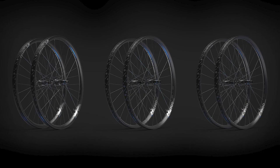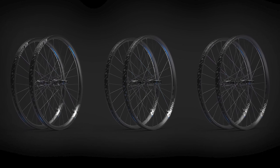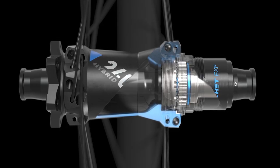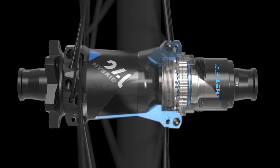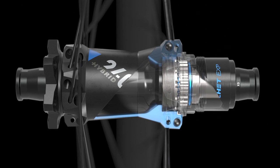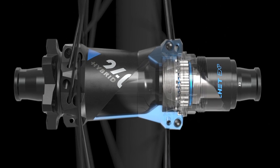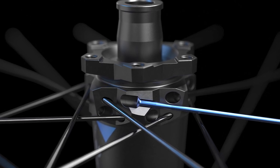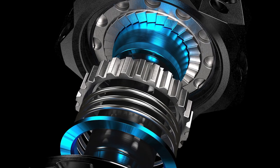When you mention the hubs, can you tell us about the details of the hubs in those new wheels? As we are offering three different wheel models, there will also be three different hub models. All hubs got a completely redesigned hub shell to match the demands of the new freehub systems as well as to match the design of today's e-mountain bikes. Beside these sturdier looking hub shells with reinforced spoke holes, we also developed and reinforced further parts of the hub and their freehub systems.